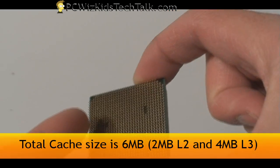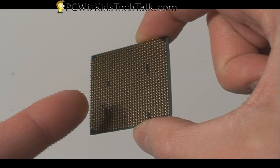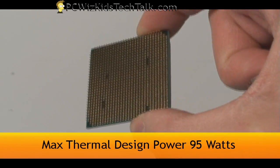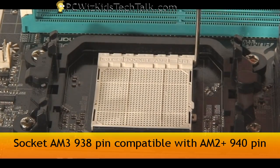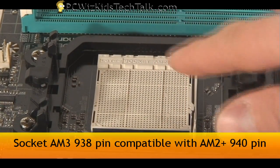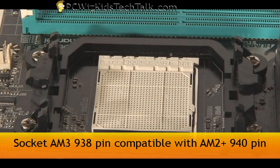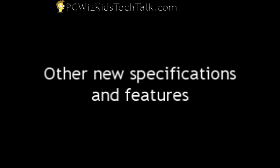I'm going to increase it. The beauty about this is it comes with 6 megs of cache, and you're going to need that internal cache for games. It's 95 watts of thermal power, which is pretty good, and it fits nicely on my AM2 Plus 940-pin motherboard so I don't have to go out and buy a new one — I just have to upgrade the BIOS to make sure it supports it. So this 938-pin fits nicely.